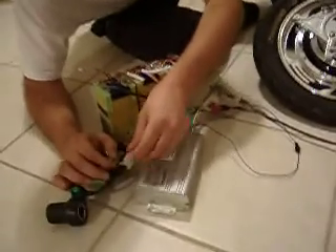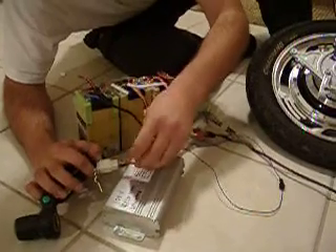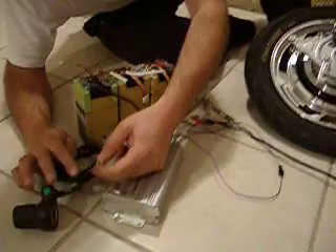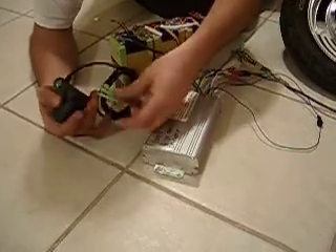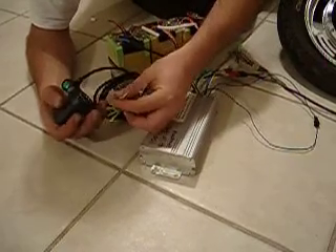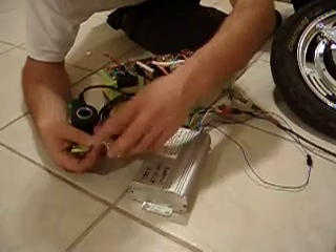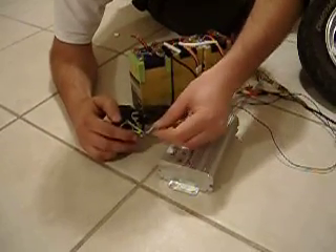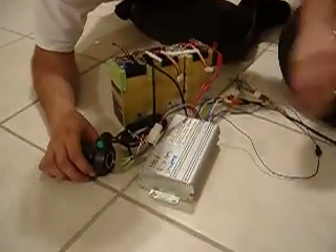Or if you hook up the brake, once the brake gets engaged it will disengage cruise control too. The brake is the blue and the yellow wires — as soon as you ground this out it will take it out. I didn't hook this up for you. One's a high brake, one's a low brake. There's a simple push button on this thing. I'd rather leave them unhooked and you hook them up yourself. But this is the brake wire for the switch, and these are the brake wires. So this can disable the cruise, or you can just throttle it on and off and it will come out.